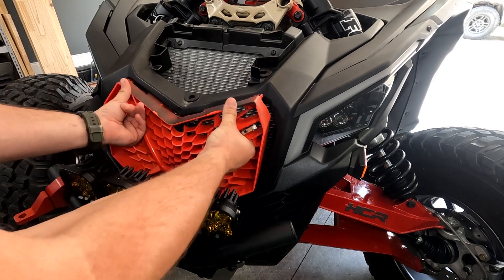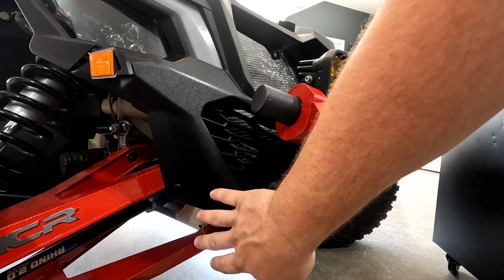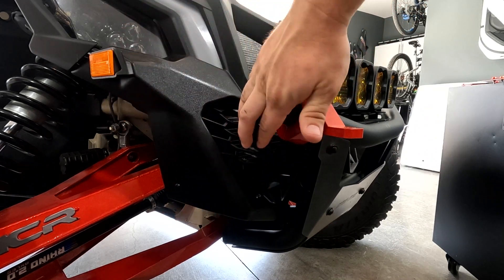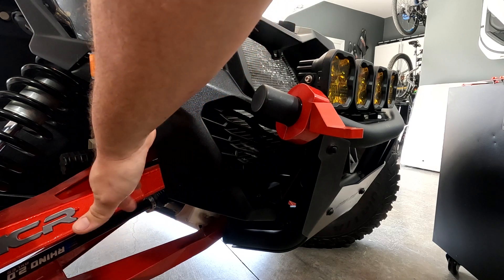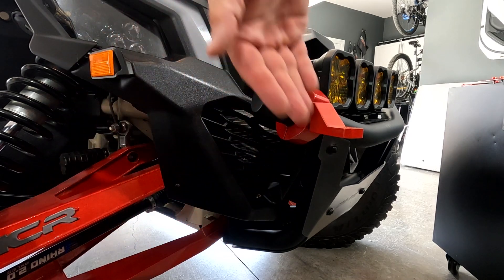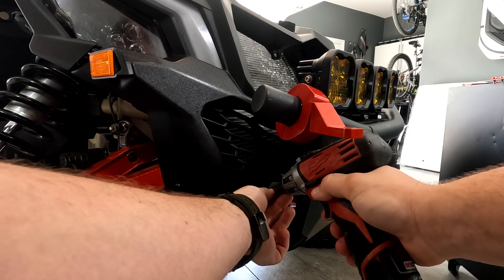The clips should just pop out. Now we need to loosen up this entire bottom piece. Some of you might have a bumper like I do, and some may not. We'll be able to lift this whole front fascia piece a little bit forward to help you fit your hand in there so you can mount the bottoms first — go ahead and loosen these screws.